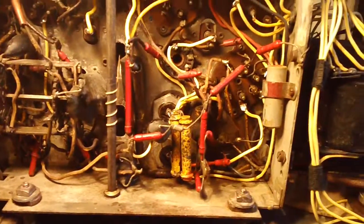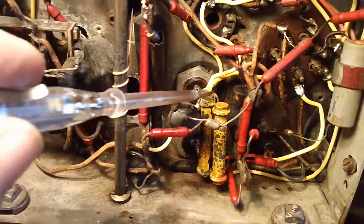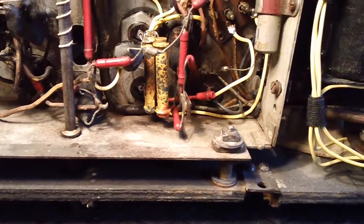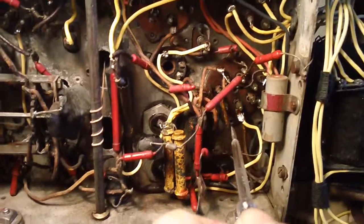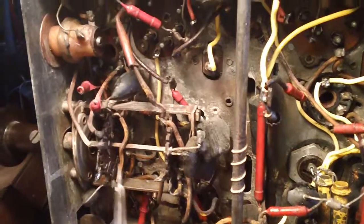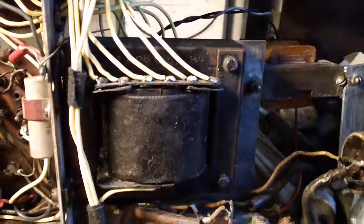Let's have a light under here. That capacitor hasn't got warm - it's where I've touched it when I tried to resolder. This should be one resistor, one big resistor, a special Philips sort. I've rewired the totally rotten wire. I just want to get it working before investing any more time in it, and my God it does work. Wave change switch will need cleaning. There's nothing that looks fried - that's not hot.